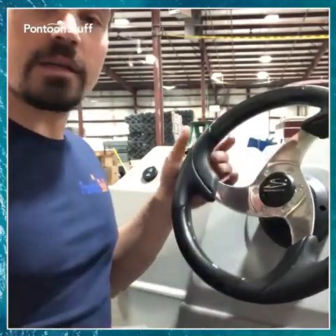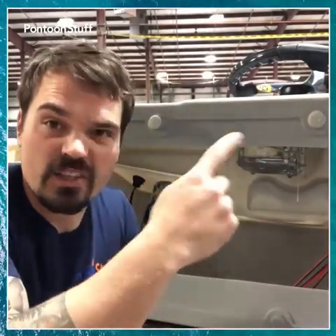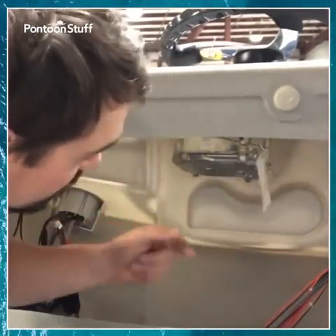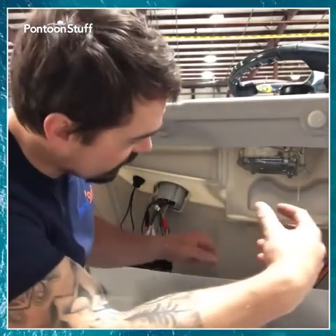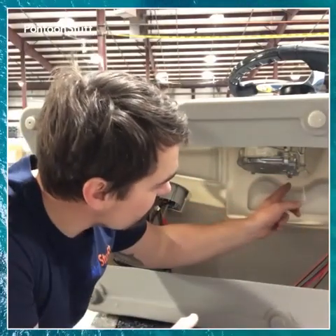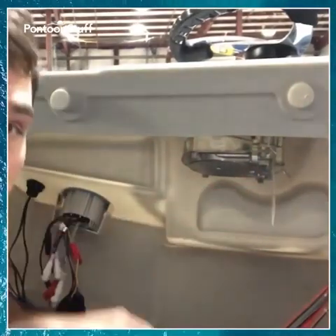Put your cap or cover cap on and you're ready to go. When feeding in the steering cable, you'll see it looks like a corkscrew on the end — that's your rotary cable — and it feeds into either of the slots. Pull the pins out and start to push the cable in. You can turn the wheel and it'll help pull the cable in. On the end of the cable there's a little divot around the brass part that's going to pop into place and lock in. There's a quick release button, and you can use the pins to push into the divot to help pull the cable into place. You'll hear and feel it pop. Once it's in place, it's set — you can't pull it out and you're ready to steer.